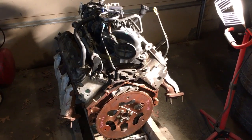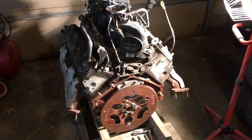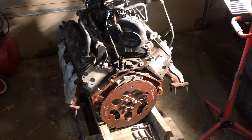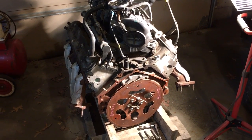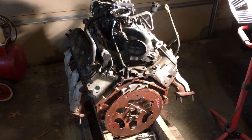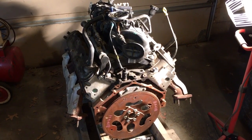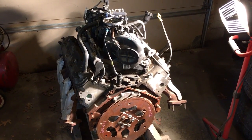This is going to be my own personal low-dollar LS build. I'm going to run an '01 to '03 LQ4 6-liter cam that is, I think factory, 467/467 lift on the intake and 479 on the exhaust. I am debating at this point whether I'm going to run a stronger seat-pressure beehive spring or just go ahead and step up to a dual spring.